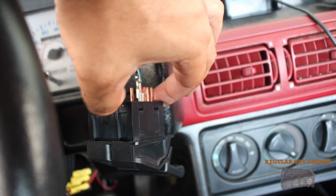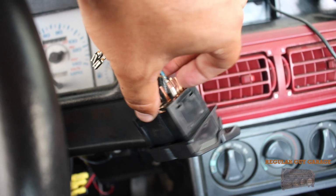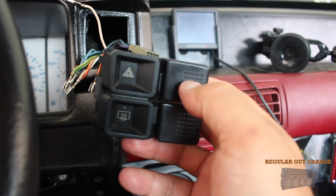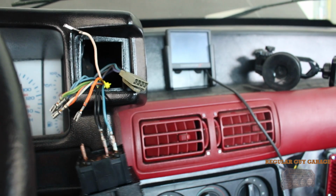So basically I'm just going to run a wire off of this third prong right here to input number 4, which is my last input, and then that'll be my scramble button. So I'll have to switch in the software so that button works off of a 12 volt supply. Basically it'll have nothing, but then as soon as I flick that button, it'll supply 12 volts. The reason for this is for when we actually start racing the car, but I can start testing it out too. I'll show you this inside the software. When I hit that button, it'll put pressure on top of the gate and give us more boost.